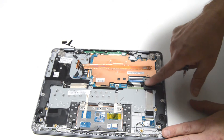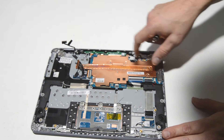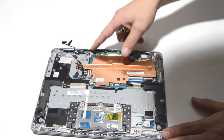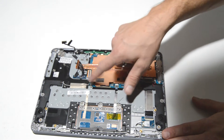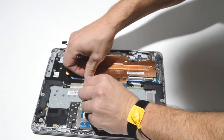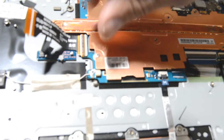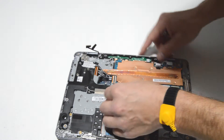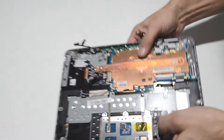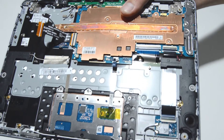Now we're ready to remove the motherboard. It is held on by a retainer bar, and there are numerous ribbons and at least one Wi-Fi antenna connected to it. We'll start from the top left and remove the cables and ribbons connected to the motherboard. On this simple connector, the two little tabs on both sides grip it and push it out. For this type, just flip up on it and it will release the ribbon — then flip it back down.